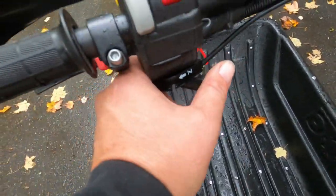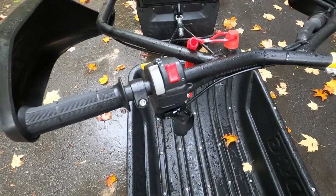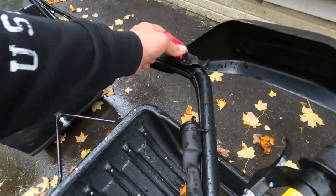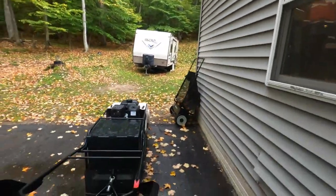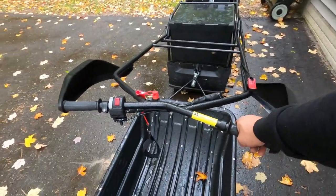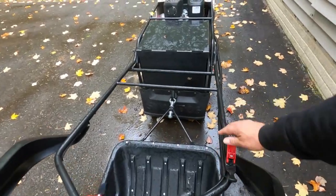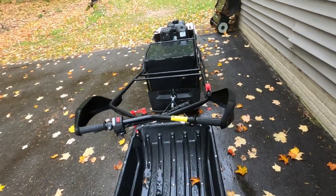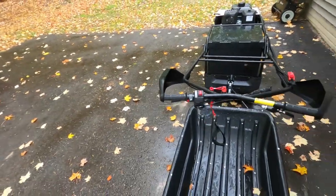Here's the choke right down here. When you don't run it for a while, it does kind of get pulled. Once again, there's a brake, and then the throttle control — you can see it pulls away. And then reverse — flip that back, you heard it kick in gear. Flip it back forward, then you just got to bounce it. Wow — game changer. Alright, turn it off, and always make sure that gray switch is in the off position.